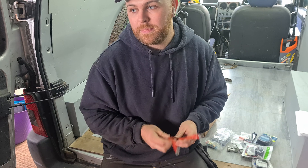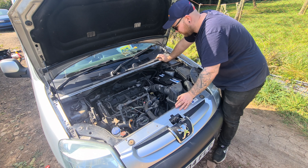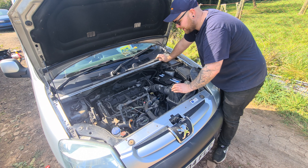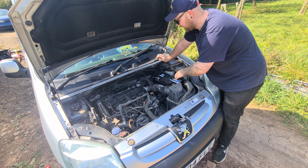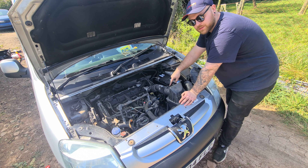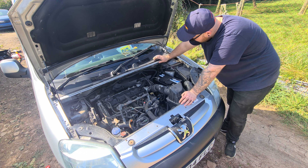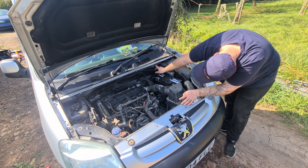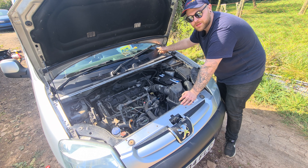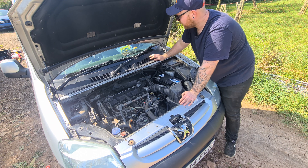Let's get back to when the weather was nice — a week ago — when I'm running that line. We need to run the power wire from the starter battery into the back of the van so we can connect it to another battery, allowing our alternator to charge our second battery. The split charge relay stops whatever you're using in the back from draining the starter battery. In this 2004 Peugeot Partner, we're going to have to drill a hole into the second firewall near the wiper motor so we don't have to take all the cowling off, and then we'll either silicone it up or use grommets.